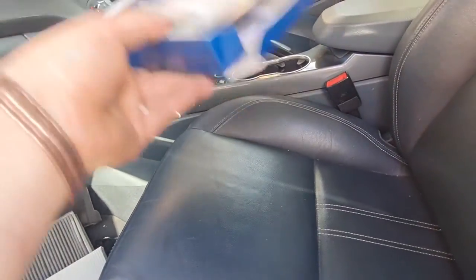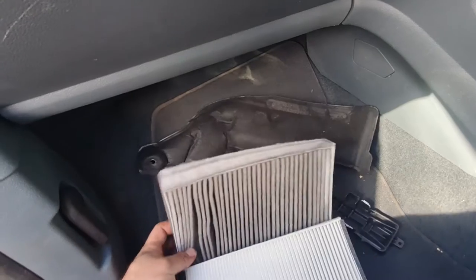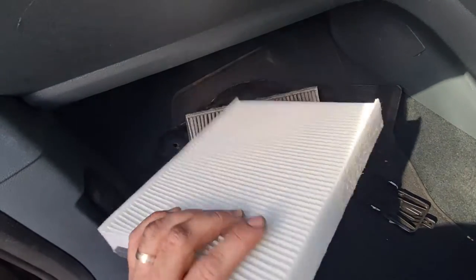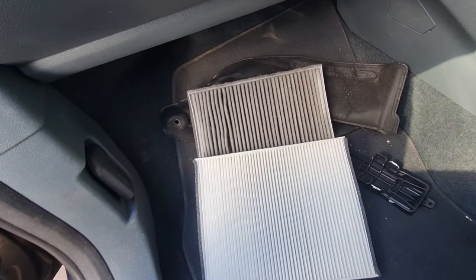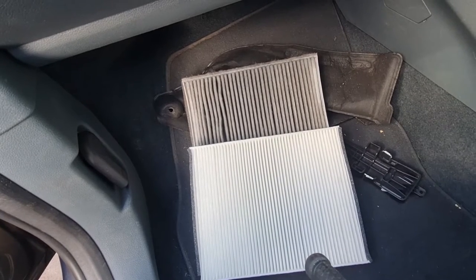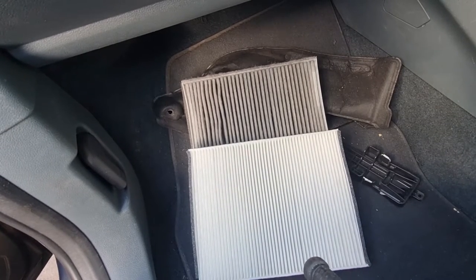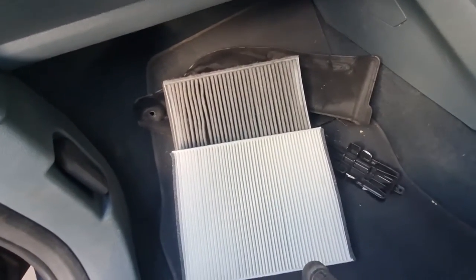There's the new one — that definitely wanted changing, it looks fairly grubby. I went for a Bosch filter. Basically I'm going to do the reverse — push it in, feed it in gently because obviously you don't want to damage the new one. Interestingly, the one that was in there was a Bosch one as well but it looks like they've changed it slightly — this looks like a thicker material than this new one. Obviously decided to go cheap on us, which is a bit of a shame — that's why I always used to get the Bosch ones, they were quite a nice almost factory filter. I'll get that put back in, clip the end back on, put the little bit of trim back in and the carpet. Very often forgotten when you do a service. I think I missed one service in between doing this job — so every other service you'll probably get away with it if you really wanted to, but if you want it to be perfect then do it every time.